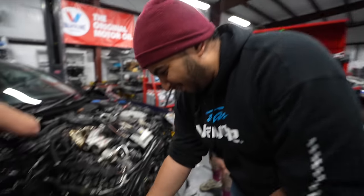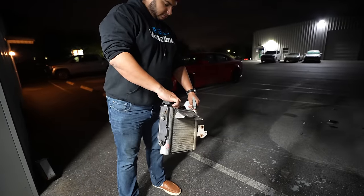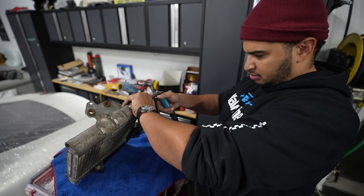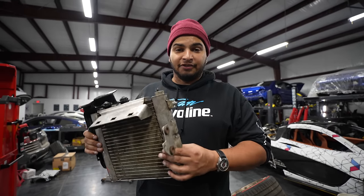So, here we go. Freddy's right. Any debris in the oil, which could be contained in the oil cooler, could end up working its way back through into the new engine. So Freddy's took the cooler outside and he's pressure washing it through. And then he's gonna use some compressed air to push out any remaining water. There's a saying in America, this is good enough for who it's for.